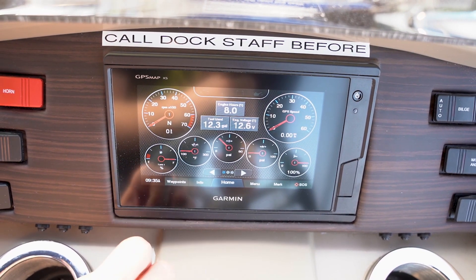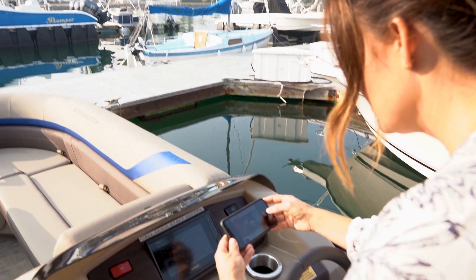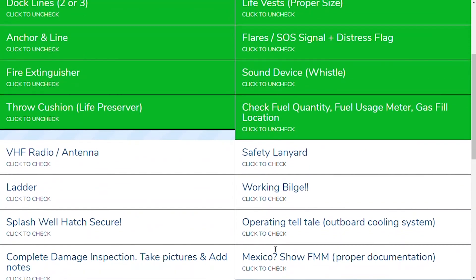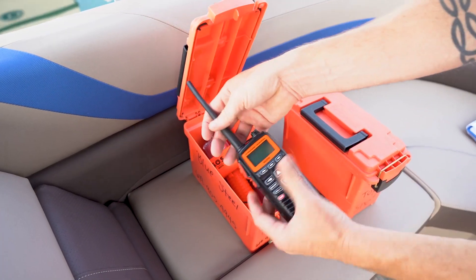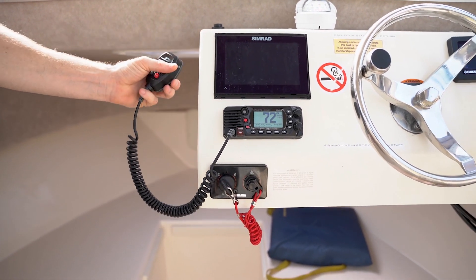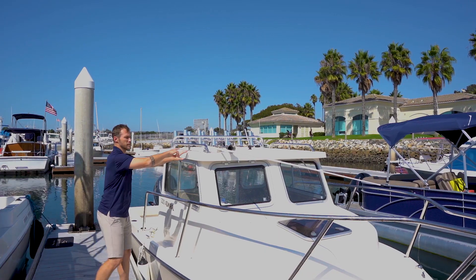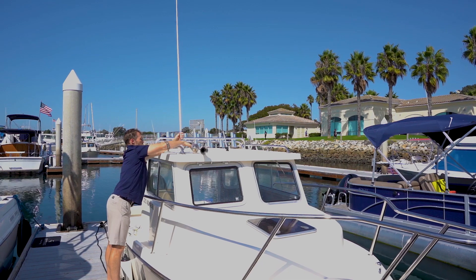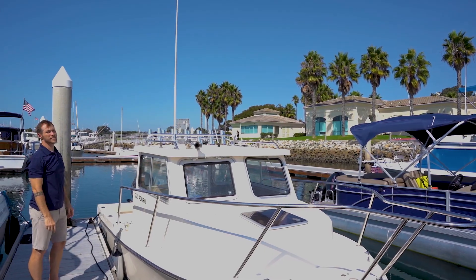Make sure to check the fuel quantity and fuel usage meter. Get your phone out and take a picture of the gauge — this will help you replace the gas when you return to the fuel dock. Next is the VHF radio. If you're on a pontoon or deck boat, the VHF radio is handheld. If you're on an offshore fishing boat, it is hard mounted. You can do a radio check by calling other frequencies — we recommend channel 72 for a radio check. Also make sure to go to the outside of the boat and check the VHF radio antenna. If it's in the down position, have the dock staff put it into the up position. The antenna needs to be in the up position.